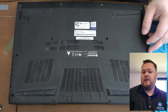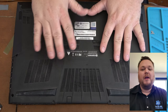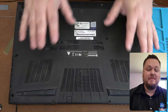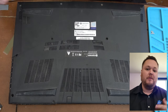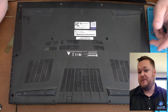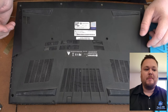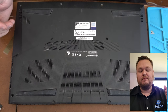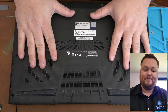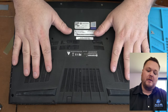We're going to do liquid metal, which you have to be ultra careful with. You need a lot of materials — highly recommend watching the video all the way through before doing it step by step. Replacing the thermal pads will help keep your VRAM cool and the overall system much cooler. We'll also wipe down all the dust. I recommend doing this at least every six months if you're running it 24/7. This one is about six months old — I got it in May, it's now November.